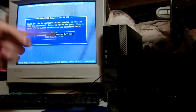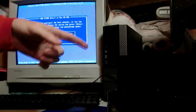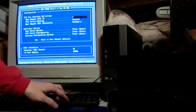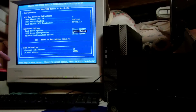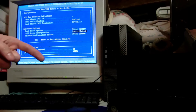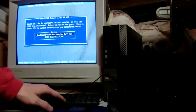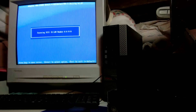Evidently that SCSI card I added has its own BIOS. In order to get this thing to work correctly, I had to go in and turn off the BIOS override. The BIOS on the SCSI card was overriding the IDE card on the motherboard, so it was no longer booting from Windows. But this card actually has its own onboard utilities, so you can scan the SCSI drives without any operating system — just using the BIOS in the card.